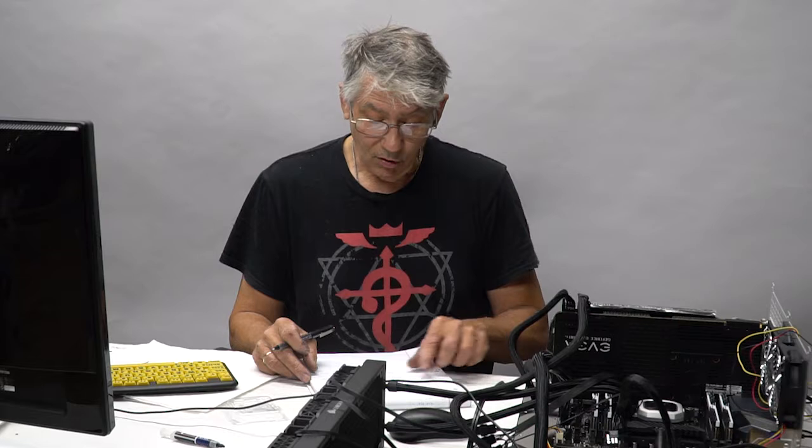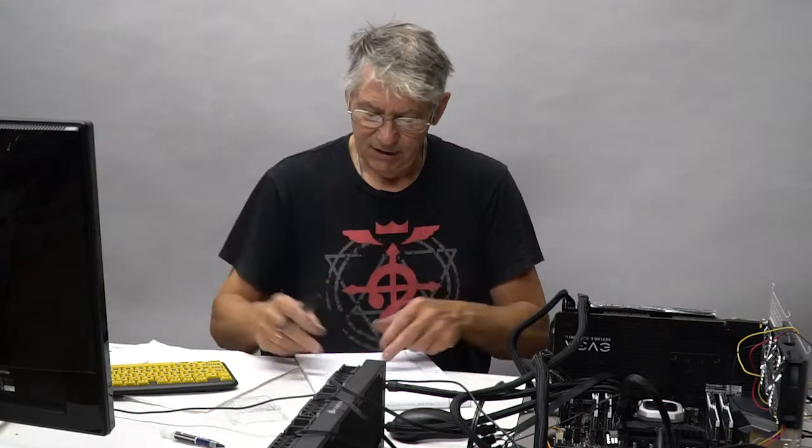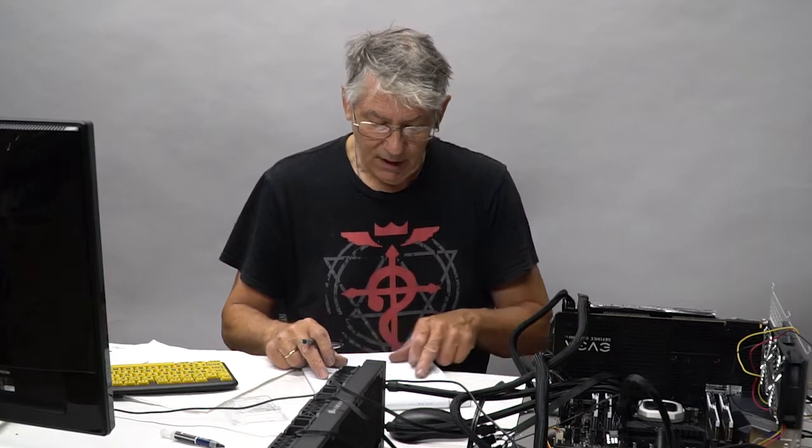My coolest cores were core 8 and core 10 at 57 degrees. So I've got a 7-degree difference at 100% throttle as opposed to a 14-degree difference. So now my core temps are much closer together. That's telling me that I'm making better contact with the heat spreader. Here's the big one though.